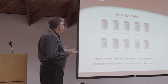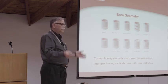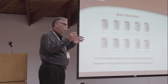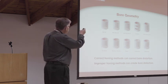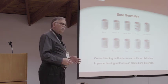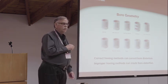If we get a cylinder that looks like it's barreling - what do we do, how do we fix that with our hone? We put the honing head where it's tight - at the top and the bottom. You don't want to dwell at the top and bottom. You want to extend it - you want to lengthen the stroke when you run into a situation like that.